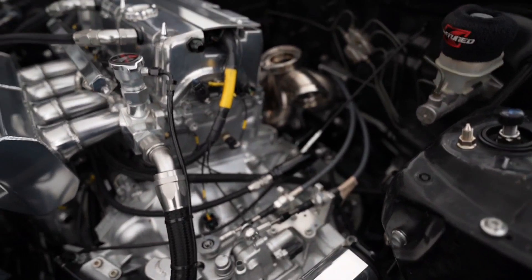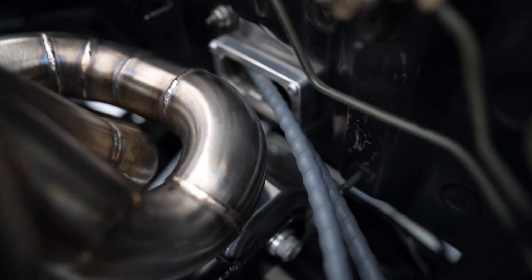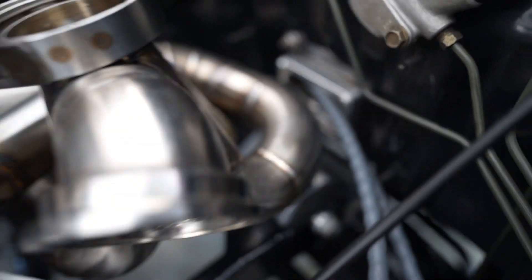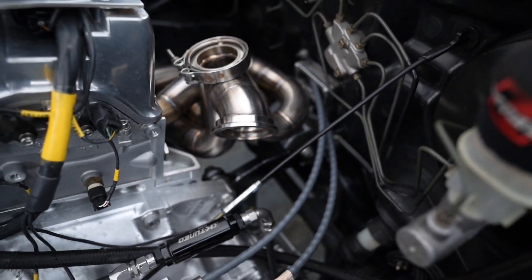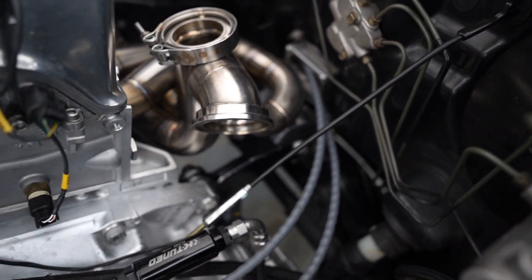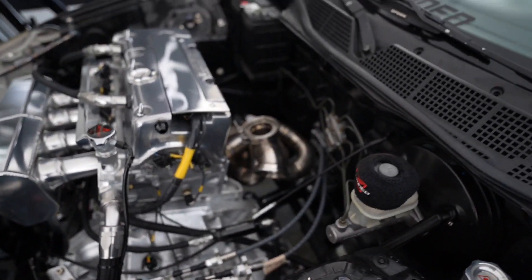This is why I test fit stuff — for little things like this so I can go over extra details to get everything just right. Like my spacing from the manifold itself to the shifter cables. I'll put a little heat wrap on those eventually to keep them safe. And I'm going to rotate my throttle body around so I have a little more slack in that cable and can drop it down so it will sit under the wastegate a lot better. Overall everything is looking good, just like I planned it.